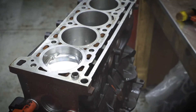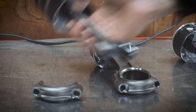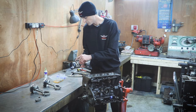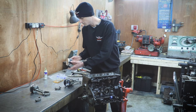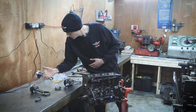So far I've got one piston in and was just about to put another one in here. We've doused it in oil, we've got assembly lube on the crankshaft on the shell, engine oil on the bore, and the piston rings have been doused in a synthetic oil more like what the engine will be using — and the skirts as well.